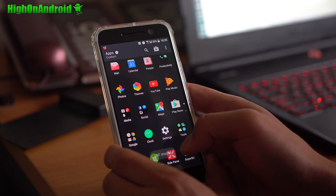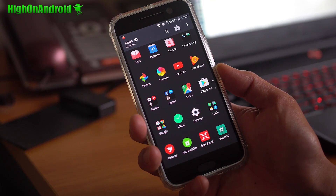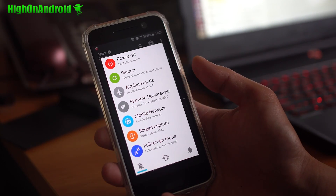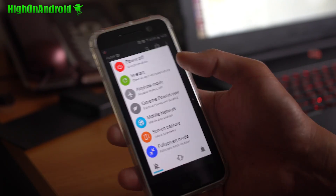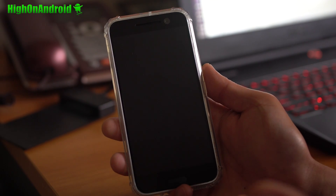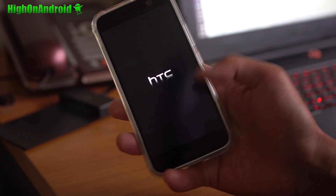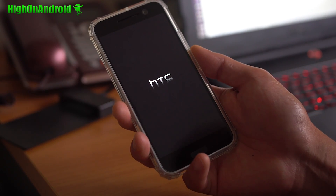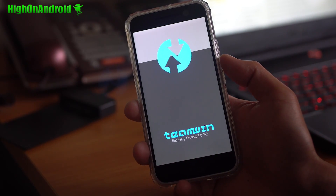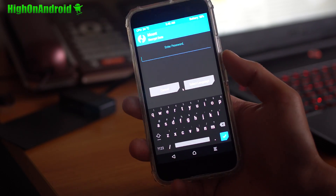This is one of their first versions and it should get better as we go along. Let me show you how to install it. HTC 10 installation is a little awkward. Download the ROM and copy it over to your phone. Boot into the bootloader — if you don't have a custom ROM installed, hold down volume down and the power button, let go when you see the logo, keep holding volume down. In the bootloader fast boot mode, choose go to bootloader, then choose go to recovery and you should be good to go.